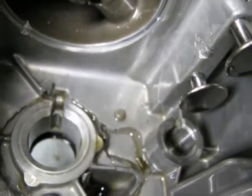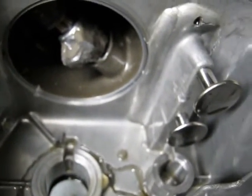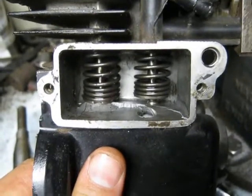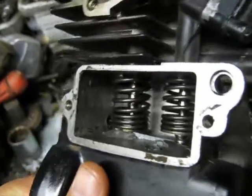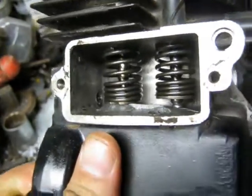Unfortunately this block's toast. I was kind of hoping for a repeat test, but I can't do it with the valve tappets way out of alignment like that. There's just unbelievable carnage going on in there — I'll move it around so you can hopefully see it better. The exhaust valve spring is off-center.